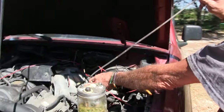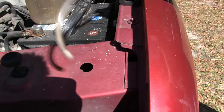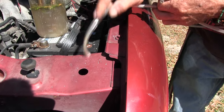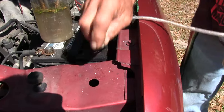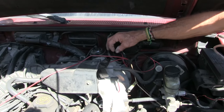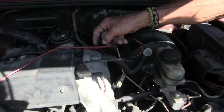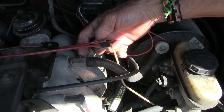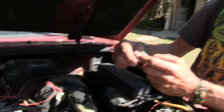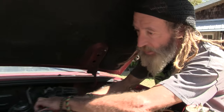I don't look like a redneck, do I? Look at this stuff coming out of here. I'll be at Walmart parking lot doing this and somebody will see me and they're like, 'that guy's got a meth lab under his hood.' This motor doesn't have a port with plugs over vacuum ports like the other motor did. So I had to rig up a place — the only vacuum I have here that's accessible is this one right here. I found out I had vacuum leaks in these little hoses, and once I plugged them and replaced the hoses, everything worked fine.